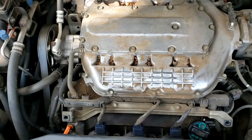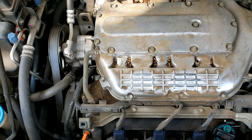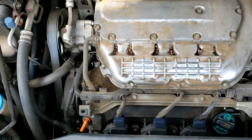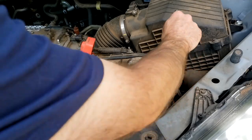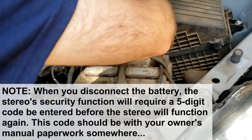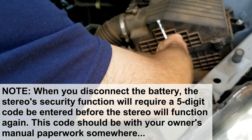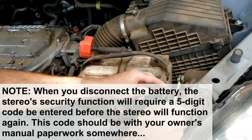Going to have to replace that alternator. Most likely it'll be no sooner than tomorrow, but as far as you'll be able to tell it'll just be seconds away. Let's get it going. First step in this whole routine is to take the negative cable off the battery and set that out of the way.